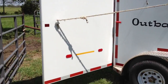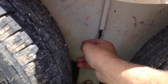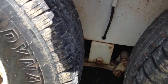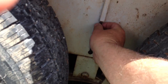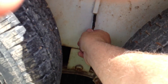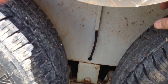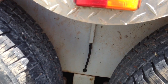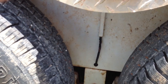The other little thing I did — I was looking after I rode over here — these wires right here. When you buy a trailer, you're going to see exposed wires, and that's normal, that's for the lights. It's usually cheap little wires. So basically I went around, and any time I found exposed wires I just put some black electrical tape on it. Electrical tape is easy, just wrap it around — it gives a little bit of extra protection from the elements. The sun can rot the rubber coating on your wiring, and if it's cracking, wrapping it with electrical tape gives extra protection.